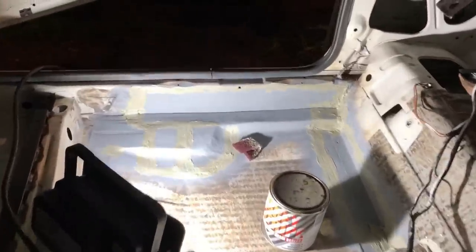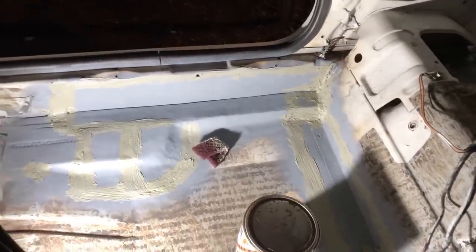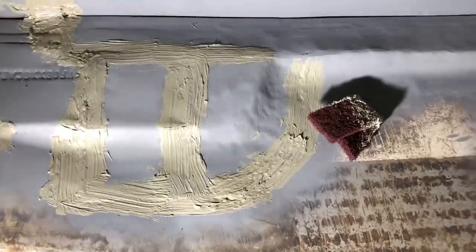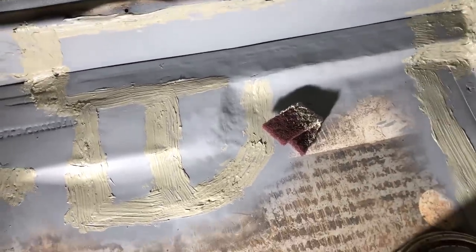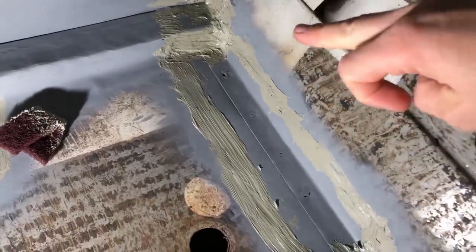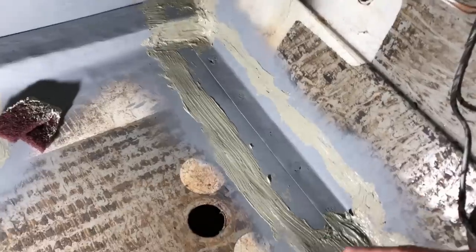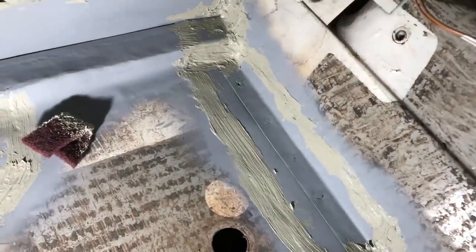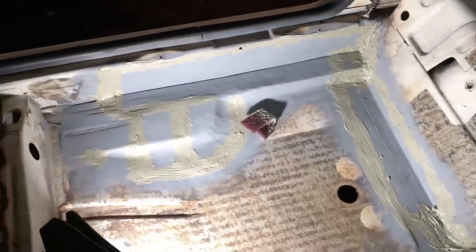After a lot of welding and metal shaping I was just seam sealing it all up and realised I hadn't taken any video today. You can see the section we left - it took a lot of work to dolly that up and shape it; this is all made from flat metal. I wanted to show you quickly before I seam sealed it - you can see how I've lipped the back section over, made this section into the corner, and lipped and plug welded it just like the factory would. It all runs seamlessly and looks just like the factory floor pan.